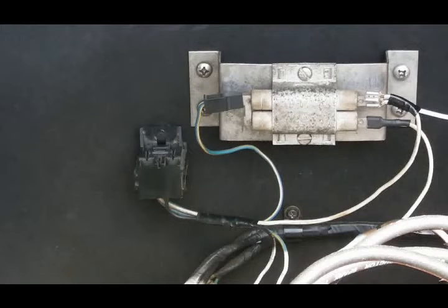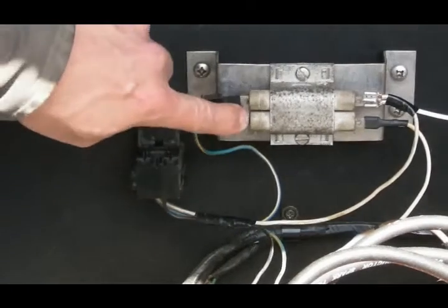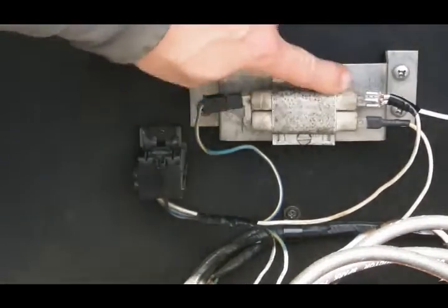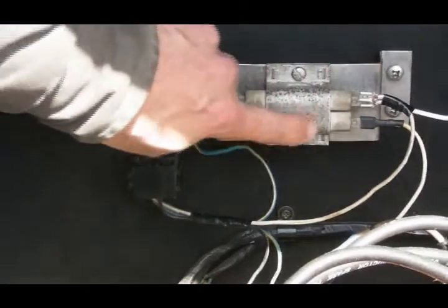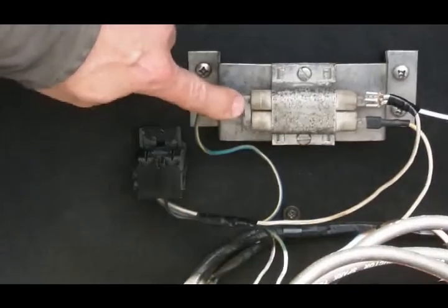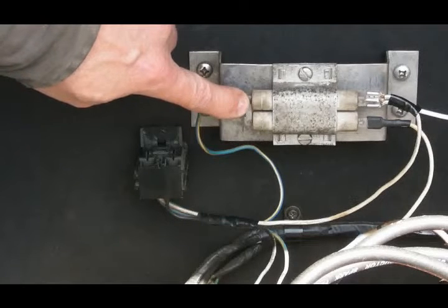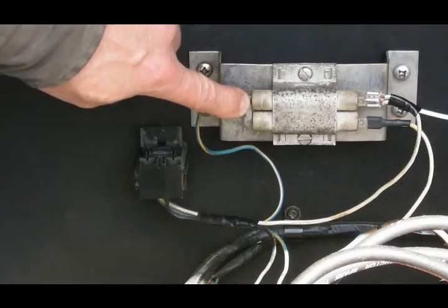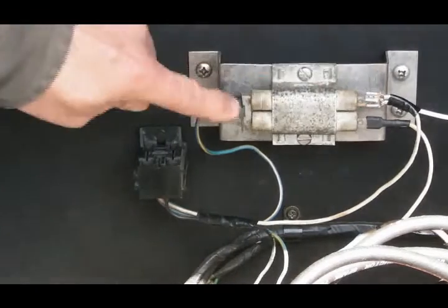So what you have to do is take one of these two ballast resistors out of the equation, so you only have one ballast resistor active during the starting cycle. The way they do that is with this wire right here — this is the halfway point between the two resistors, shaped kind of like a letter U. It goes in through the bottom and out the other side. If you put voltage on the halfway point, you've taken one of the two resistors out of the equation.